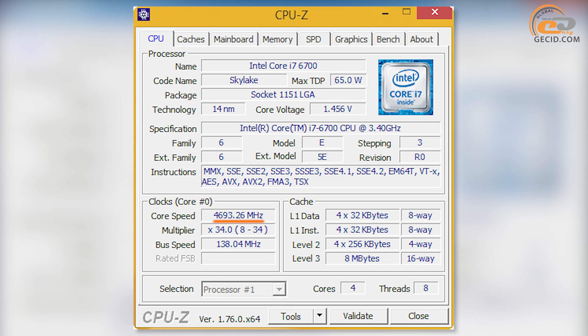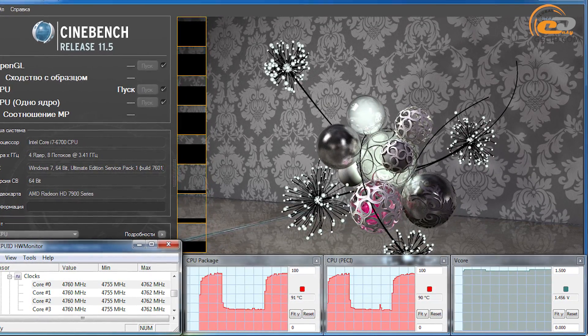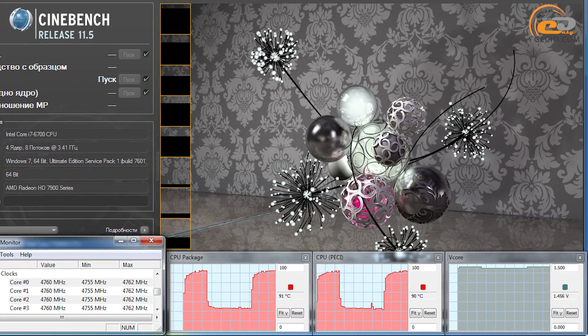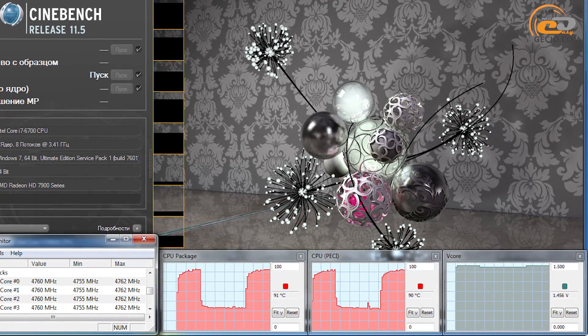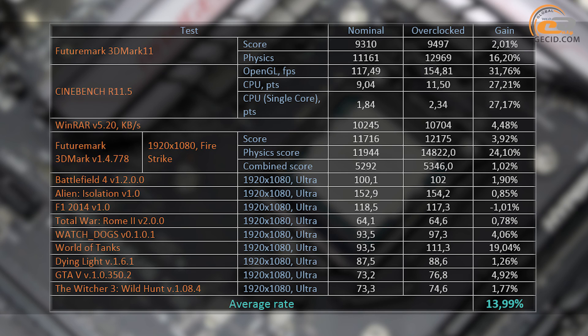It is just a great result which makes the tested processor a more attractive purchase, especially compared to the more expensive K-suffix version. During overclocking, the supply voltage reached notable levels, and power consumption increased by nearly 100W. The processor itself heated up to 91-94 degrees depending on the benchmark — just remember that the critical temperature point is 100 degrees, after which throttling is enabled. The real growth in system performance amounted to almost 14%, which is even higher than overclocking the i7-6700K by multiplier increase alone. The only requirement is a decent aftermarket cooler, as the included one will likely fail to cope with the increased heat.